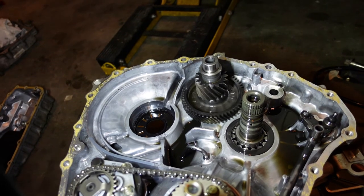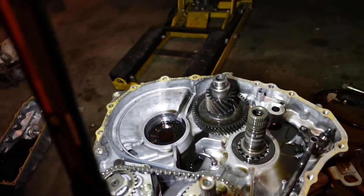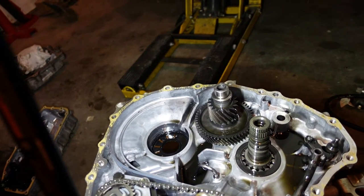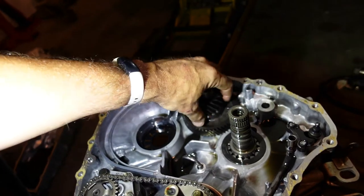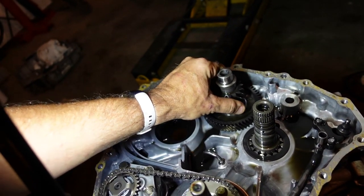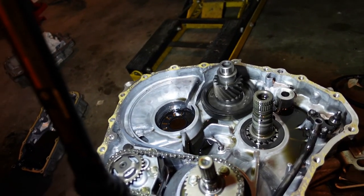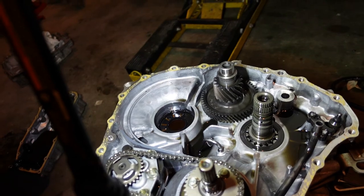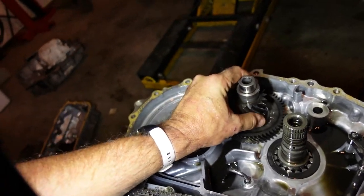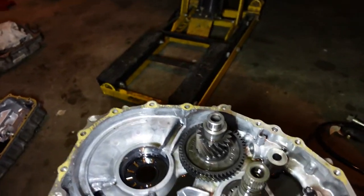I don't know how I'm going to pull it out yet, because that shaft is jammed in the bearing. So that's definitely what we have. We have a failed bearing on that shaft. That is what was causing all the noise. You can hear the ball slapping around, and that was what was causing this to move enough to eat the sensor and ruin the sensor.